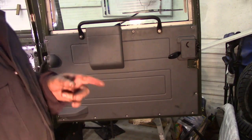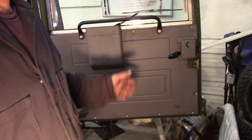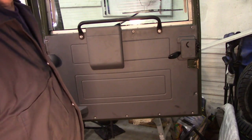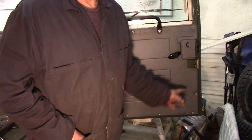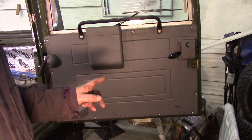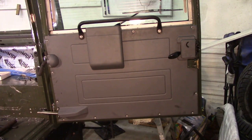And one tip I want to tell you is that before you box it all up and things like that, just make sure the wiper's working and you know it's parking properly, because it's a pain in the backside to take it all back out again and do it. But I'm very impressed. It's a lot better than the Mud UK one, I must admit, because the Mud UK one you had to fit little brackets on the sides. It was a bit fiddly. This is really easy, but be prepared to do some cutting around here and some trimming around these bolts down here. I'll probably zoom in a little bit and you'll be able to see what I was talking about.